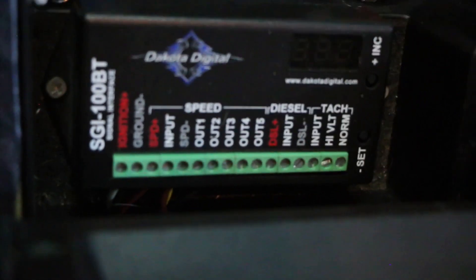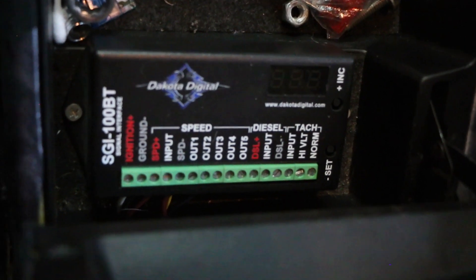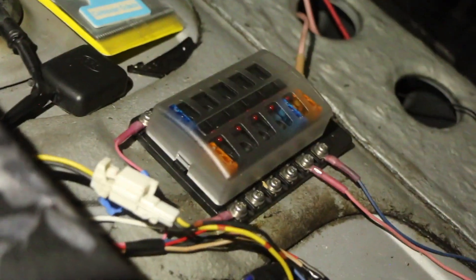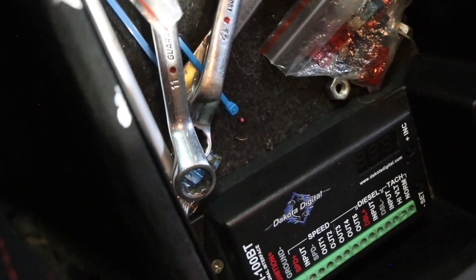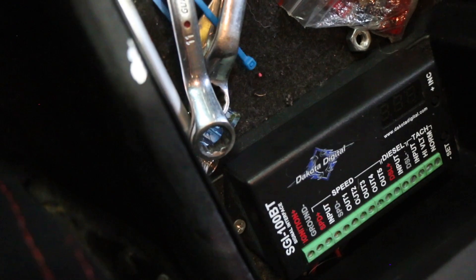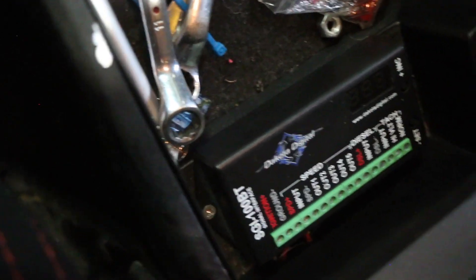The way I got this wired up: I got my ignition, and this is going to be for every setup — you're going to need your 12-volt ignition. I have mine fused off; I ended up adding an external fuse here, fused off to a 12-volt ignition. Make sure the wire you tapped into has a 12-volt accessory on, so when you turn on your accessories, this will also be powered. Then you're going to get your ground, which is going to be that second input there.